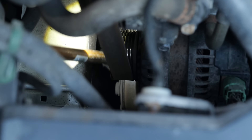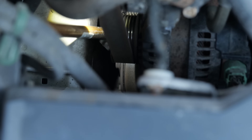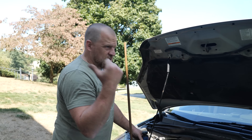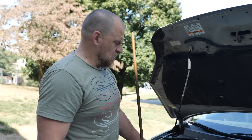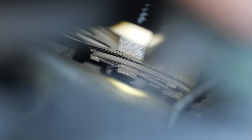I can turn the front face of this compressor no problem, which means the compressor was not locked up — this was just a clutch failure, Aaron. That means you're in good shape. The only thing we can't do at home is recover the refrigerant — we'll take it to my brother's shop, pull the refrigerant out, do the repair, then we can do the rest. You can see it clearly — the pulley on that is tweaked because the bearing went. There's no concern about the motor, Aaron.